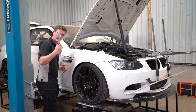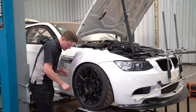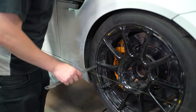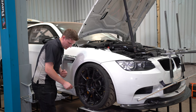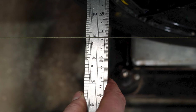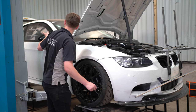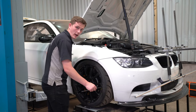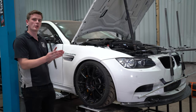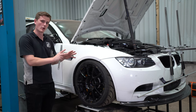When taking measurements, use a steel rule with accurate half-millimeter to quarter-millimeter readings. Place it on the back edge of the rim and slide it up until just below the string without making contact, keeping the rule nice and flat. Here we're getting 76mm at the rear and 80mm at the front. Using our equation: x minus y = 80 minus 76 = four millimeters of toe in at the moment. We'll be adjusting that to get the setting we want on this car.